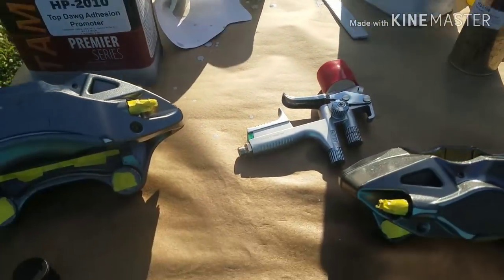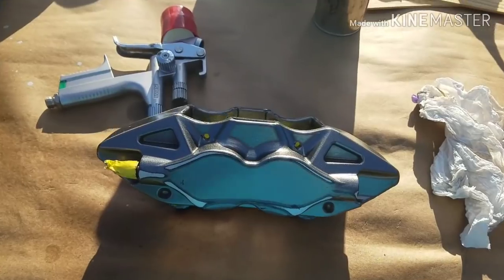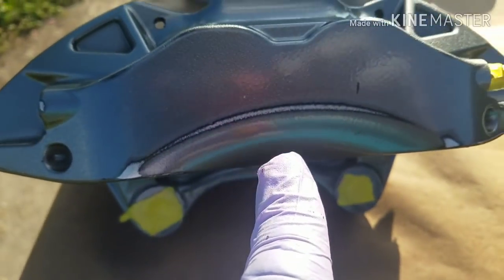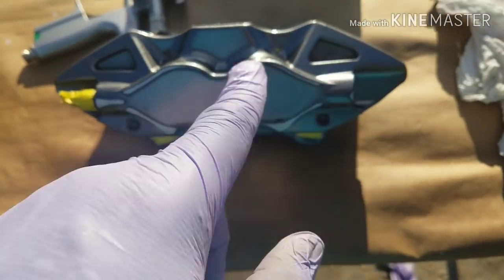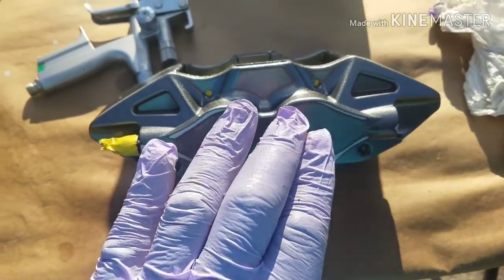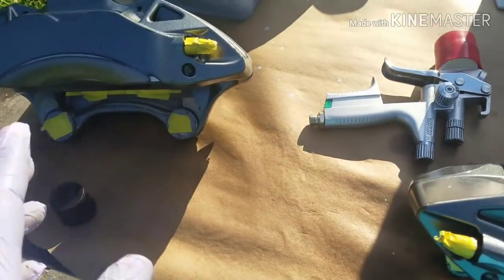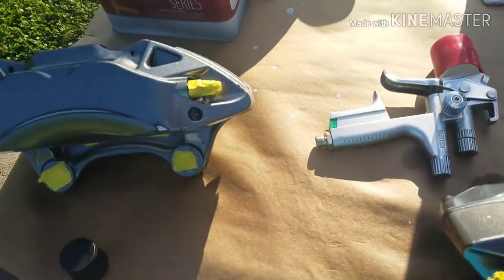It's bikes, man. So I always spread it on my brake calipers before I go in with my paint. But in this case, since I had to sand off the decals, I'm gonna see how those low spots are. I'm gonna spray me a little sealer just around here. Then after that, I'm gonna let it flash off 10-15 minutes. Then we're gonna pound on the paint.